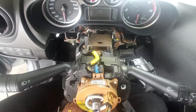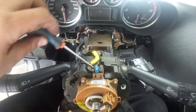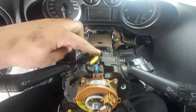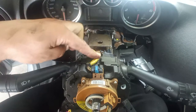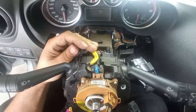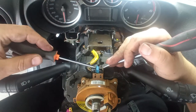A cool thing about these jobs is that you can use the seat to your advantage for a comfortable position. You have here this top blue connector — black with a blue tab — and it is very fragile. The wiring here was not well done; it was in that valley pressing against the trim, and you can see the wear marks. That can produce noise or a wiring fault in the future, so let's do it as it should be done.